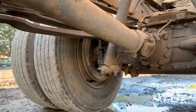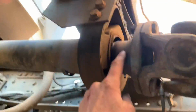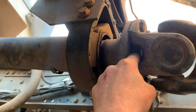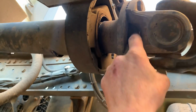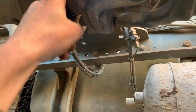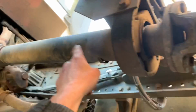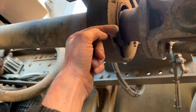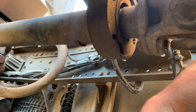on the floor, just leave it on the floor, leave that side bolted, leave it on the floor out the way, and then we're going to be left with a flange here, and there's a bolt in there, look, that holds that flange in. I'm going to take that bolt out, and then the flange is on splines down here, onto that prop there. There's splines on this prop, that's got splines in it, and then we're just going to remove that.